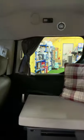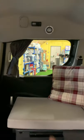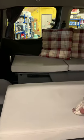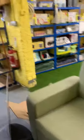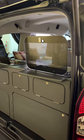So I think that's about all I can show you. To recap: I've shown you under the bonnet, the hookup on the outside, all the bits behind the back door, and the Eberspächer heating above the offside sliding door — you just turn that on and choose your temperature. It works via the diesel tank; as long as you've got about a quarter of a tank of diesel it should turn on. It can be a little noisy at the start, and you will hear a ticking noise when it's running — that's perfectly normal, it's just the diesel pumping through the system. If you have any questions or think I've missed anything, let us know. Otherwise I look forward to seeing you soon to collect your van — thanks very much.